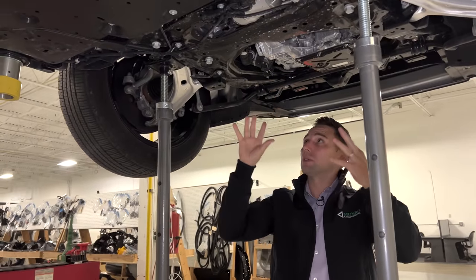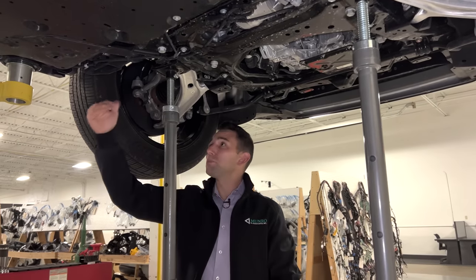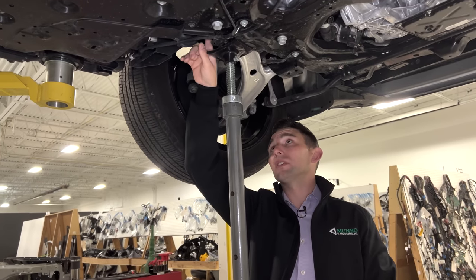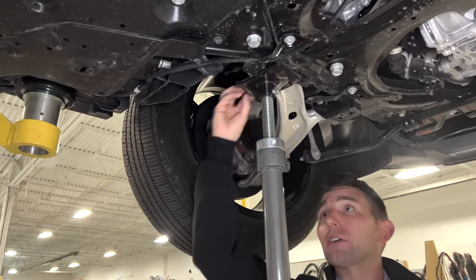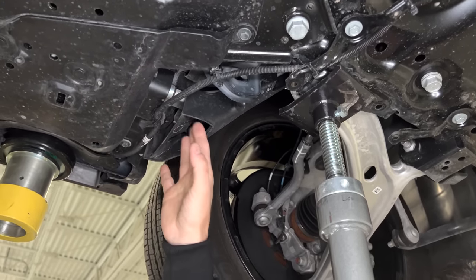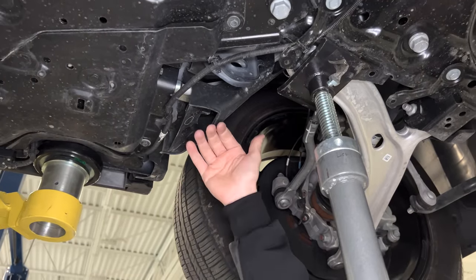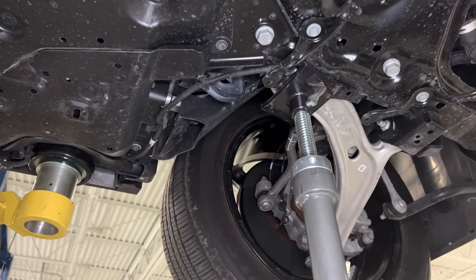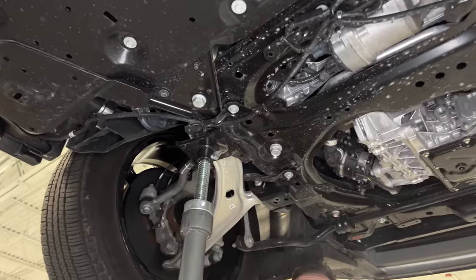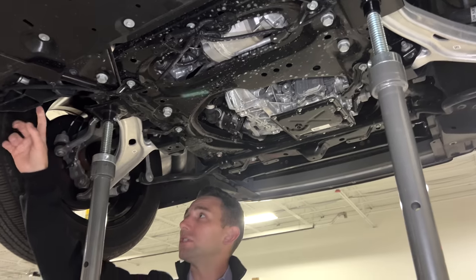Well, when it ends up here around the EDM and all these components, you also need a way to extract it. It's hard to say without having all the CFD information, but it could be that they're using these ducts to help provide some actual suction, via the open end on the bottom here, via Venturi effect. They could actually be providing a way for that air to escape and go underneath the vehicle and out of this area. If hot air gets trapped here, it's not good for most things that live in this area of the vehicle. So kind of an interesting little feature there.